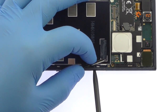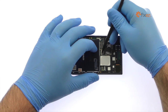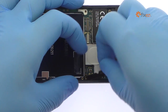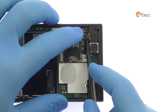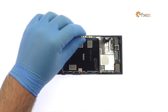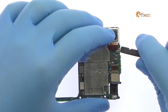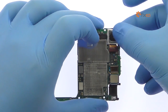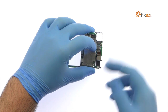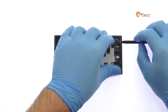Remove the Sony Xperia XZ power button with fingerprint sensor. Remove the two plastic brackets. Disconnect the headphone jack cable. The Sony Xperia XZ motherboard pops out of the rear case with ease. Remove the 23-megapixel Sony Xperia XZ rear-facing camera from the motherboard, then detach the 13-megapixel front-facing camera. Plug out the Sony Xperia XZ headphone jack.